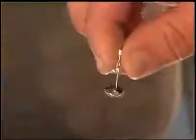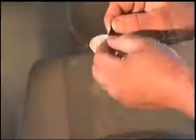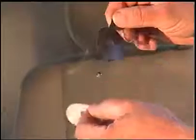damage. First, use the enclosed push pin to clean any loose pieces of glass from the damaged area. Next, use the alcohol towelette to clean around the damaged area, both inside and out. It's suggested you place a cloth near the bottom of the windshield to catch any resin that may flow down from the repair area. Peel the backing from one side of the adhesive disc.